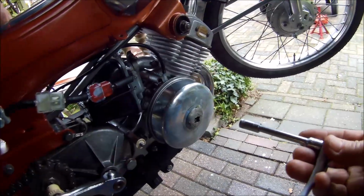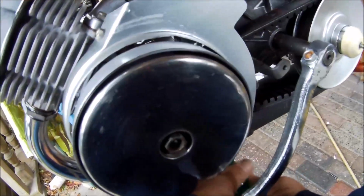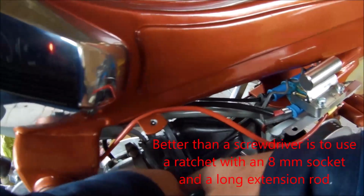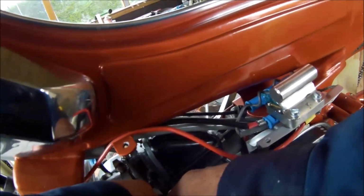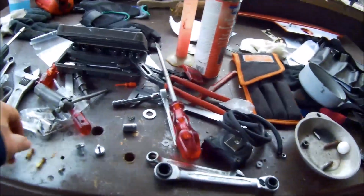To remove the nozzle in the easiest way, you untwist that a little bit. This, you need to take such a screwdriver and an 8mm wrench with you to be able to do this on the road, because one of the main reasons of getting trouble on your way is a plugged nozzle. Okay, that's the one that I fixed yesterday, and now I replace it with this one.